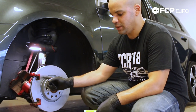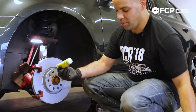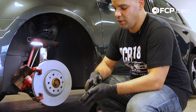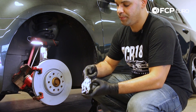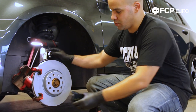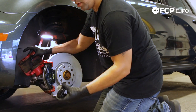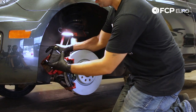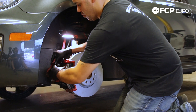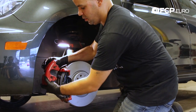Now we're ready to install our new brake pads. This kit comes with Techstar OE pads as well as Techstar Ceratec brake lubricant. I recommend applying a good amount to the rear of the pad, specifically on the ears that slide in and out of the caliper bracket. This rear pad does not have any clips and there is no sensor, so this one is for sure the outside pad. From here, we're going to locate the clips inside the piston cup — you should hear it snap in. Once in place, we can disconnect the hanger and come into position.